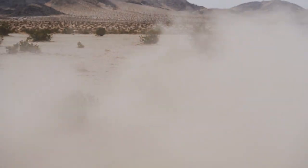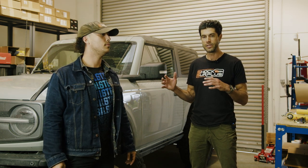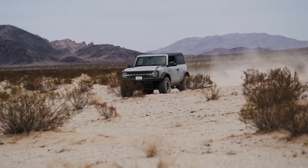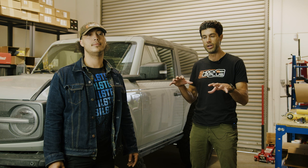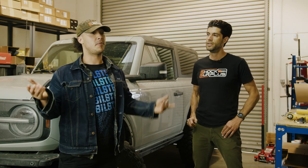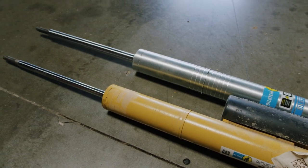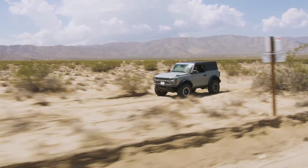We use the terms low-speed support and mid-speed support a lot around here. Low-speed support is daily driving — commute, highway, easy gravel. Mid-speed support is when you're on the pedal at 20–40 mph through moderate terrain, really starting to articulate the suspension. For low-speed and mid-speed stuff, the stock ESCVs were just too stiff. For high-speed stuff they were great — until they surprised you. They were probably the hardest you could charge on a two-inch body shock I've ever seen. The 5100s, though, are way more comfortable at lower and mid speeds, but they just blow through travel, bottoming out and topping out way too easily at high speed.